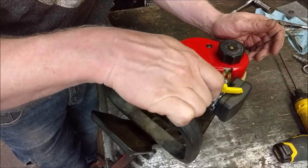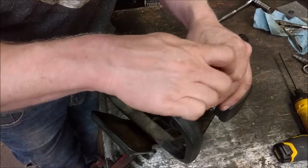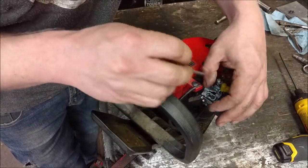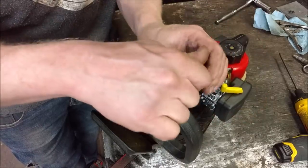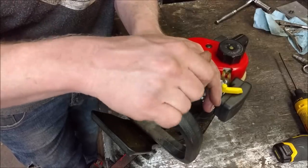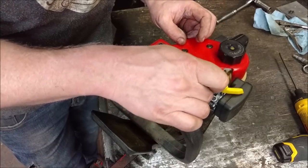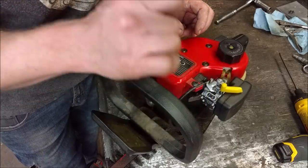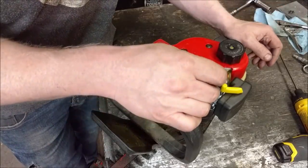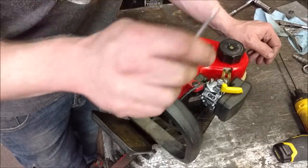Both needles are actually shut. And these aren't fixed jets — you carburetor guys will know — these are tapered needles. The problem is it just gives way too much fuel. You adjust these off of their seat and it's just too much fuel and it bogs it out, so it's running way too rich. It is running. I have the high side just barely cracked — one one-hundredth of a turn. I thought that made it run just a little bit better, but any more than that and it just bogs right out with too much fuel and dies.